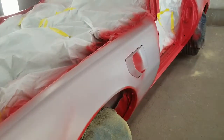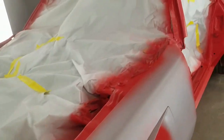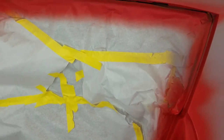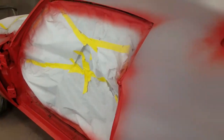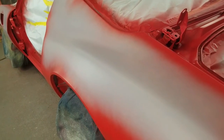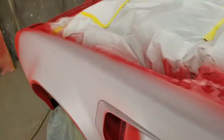You'll notice that I sealed this car — pretty much everything. For all you painters out there, you want to make sure you seal, mainly because today's paints are so transparent. It makes the base coat cover even nicer. So you want to find a sealer that's pretty much the same shade as the base coat you're doing. Paint is not cheap — Deltron is $1,200 for 5 quarts.